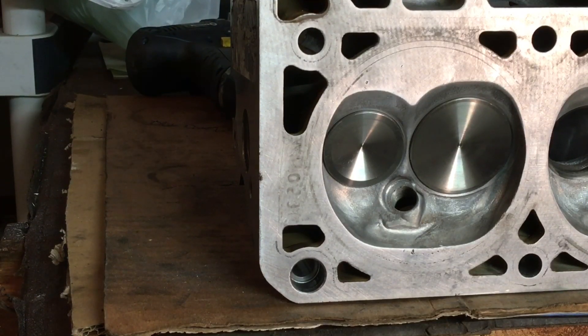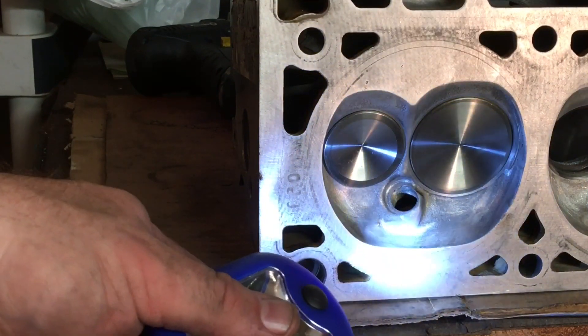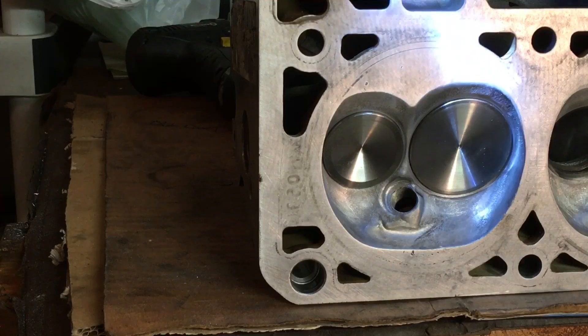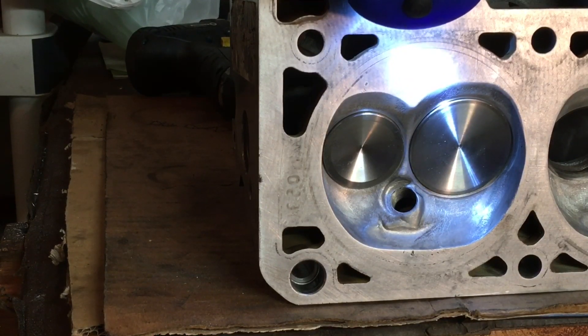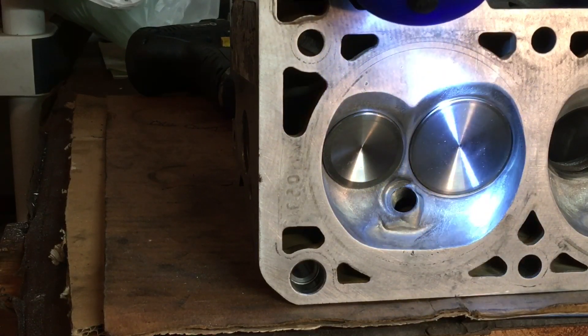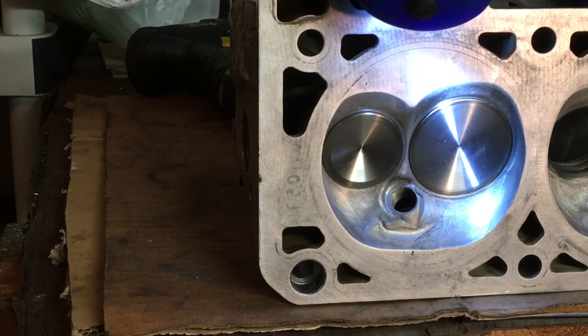We have nothing so far — I'm working at night. There's absolutely no leakage coming around that valve. That 202 intake valve is seating and sealing perfectly on that factory two inch seat. So it just makes you wonder. I hate to say sloppy mechanics for the win, but if you don't have to pay several hundred dollars to get a new valve job, then why would you waste the money?